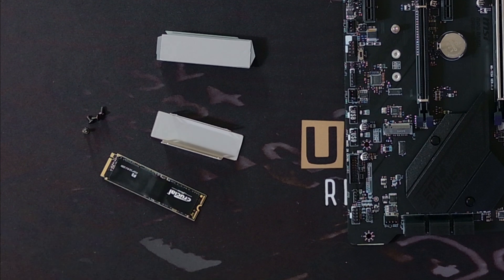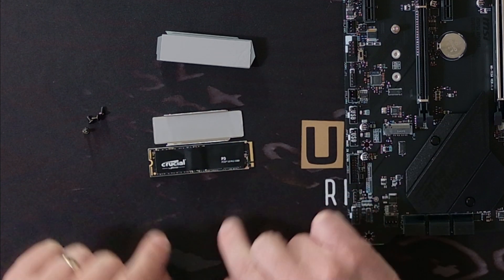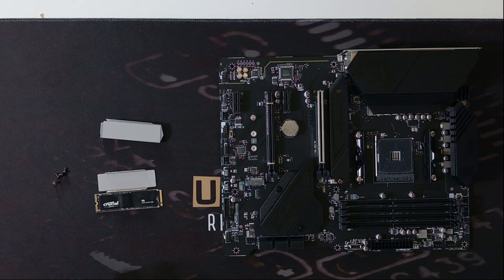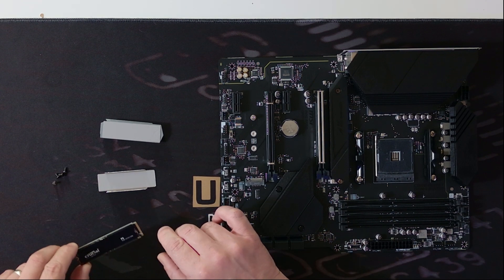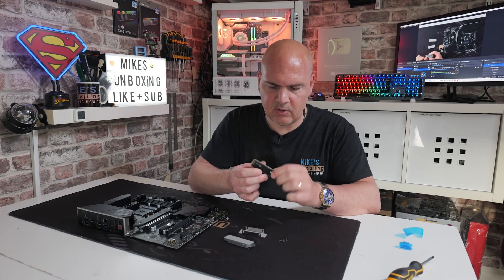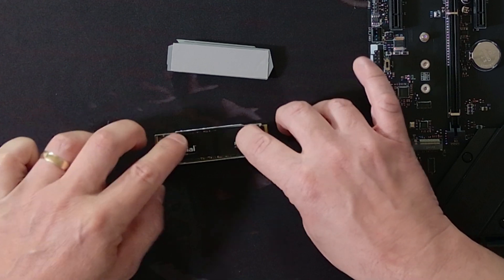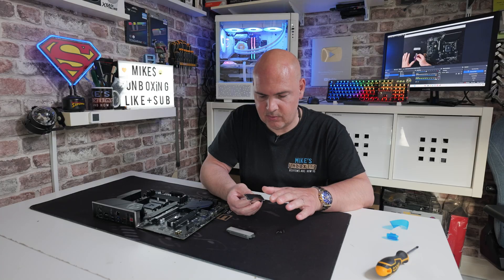So we've got our two sections ready. Now with our drive — the good thing about this is the physical size of the drive enclosure is actually a little bit smaller than the length of the drive itself, meaning you don't have to be too precise about the overhang at either end for the M.2 slot or retention mechanism. Depending on how you're going to install this into your board, you can consider which way around it's going to go — but that's going to be more important for the top part. And regardless, if this is a single-sided drive like this Crucial P3, on the backside there is nothing, but you can still put the thermal coating on there — it's absolutely fine.